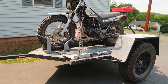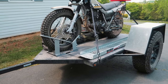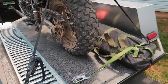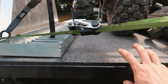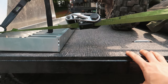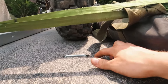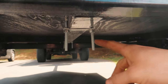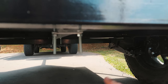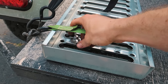What you saw there was a little filming I did on our way to our campsite this weekend. I just got back and you can see it's all nice and dirty and dusty. For the floor, I took a piece of plywood and then used some Raptor liner — the same stuff I've done my bumper in — and rolled that coating on there. I chose wood so it's easy to replace and easy to mount stuff to. I mounted it using U-bolts right under the frame. I went ahead and took my ramp and just did some holes with wing nuts, washers, and bolts.